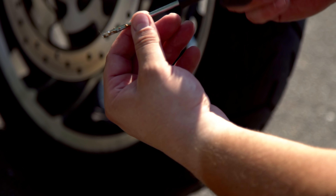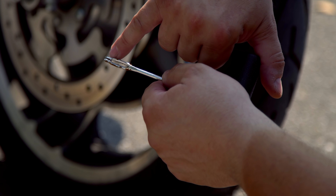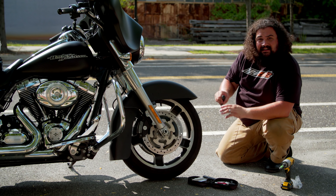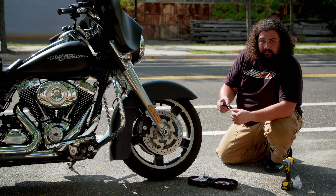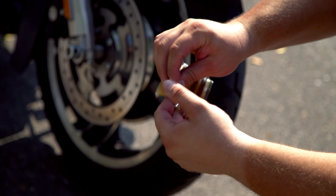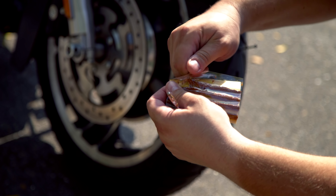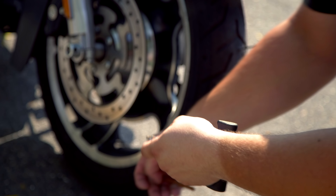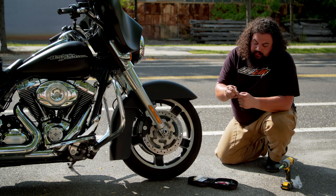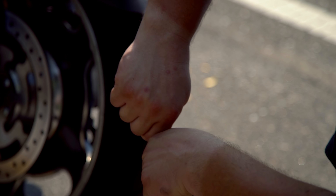Now the other tool, probably the key to the whole operation, is the plug insertion tool. We're going to work a plug through this thing. If you notice at the end of the tool, there's actually a slit cut into it — that slit is what allows this tool to deposit the plug inside of the hole. These string plugs are pretty gooey and sticky, so I'm going to load one into my tool. A little bit of spit as lubricant can help work the plug into the tool. You're going to get it about halfway through.